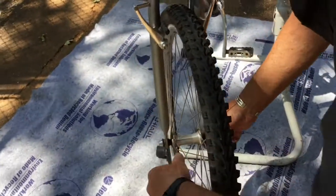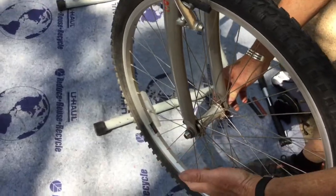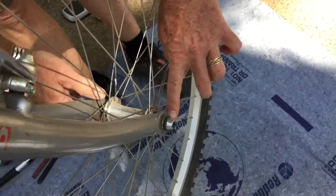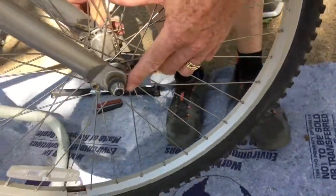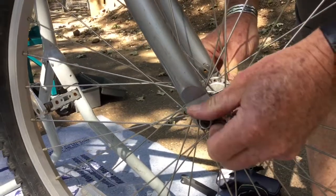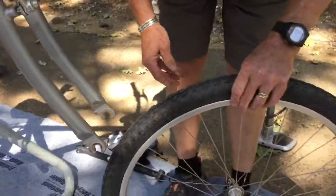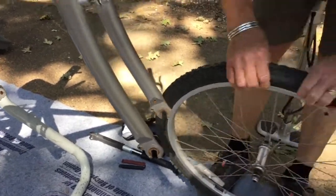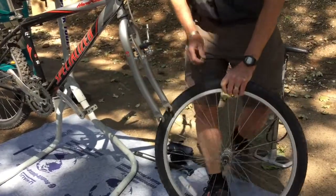And then there's an additional step these days, because for that very reason that a lot of people don't use a quick release properly, there have been catastrophic crashes where a front wheel falls out because it wasn't properly tightened. So now modern bicycles have little tabs on the end of the fork. You should maybe see them better when the wheel is out, but there's little tabs here that prevent the wheel from coming out if the quick release isn't properly tightened. So in order to get past those little tabs, I need to loosen this little nut on the other side of the thing, and now it can drop out. Here again, you can get a better view of those little tabs there that help to hold the wheel in place. So, now I have got the wheel out,